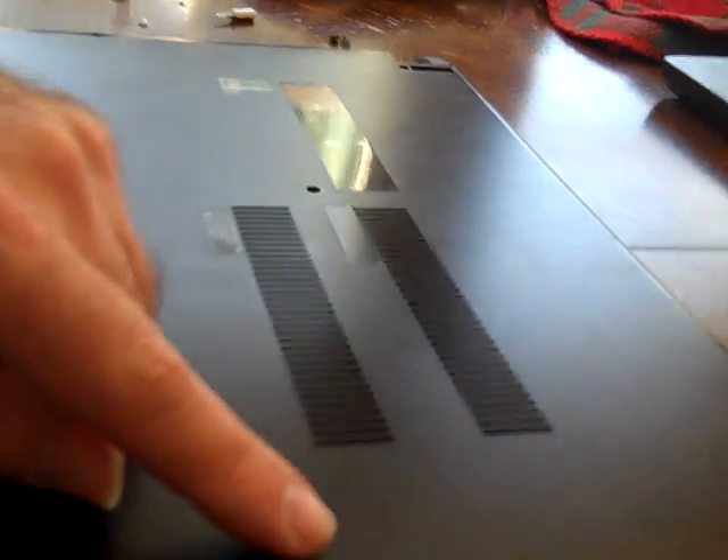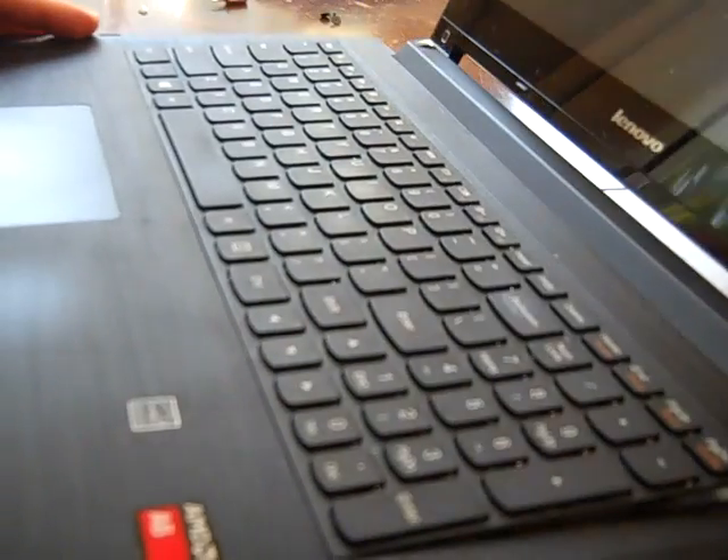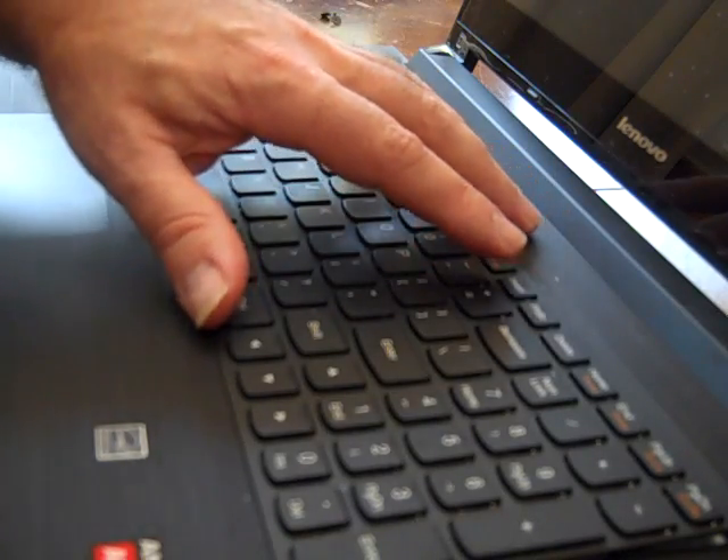On the back of the laptop there are certain mounting screw holes, so we have to unscrew all of those screws as the first step. Second step is to flip around the laptop and open it up — there are a couple of mounting holes hidden underneath the keyboard.